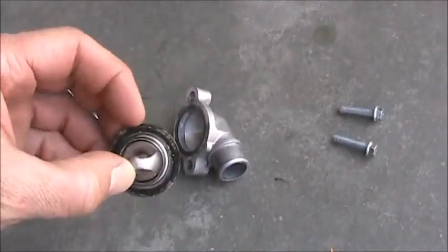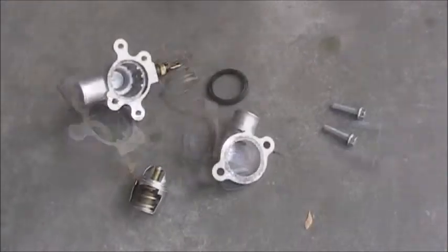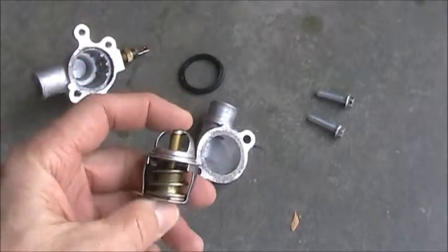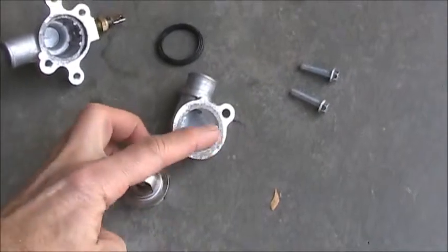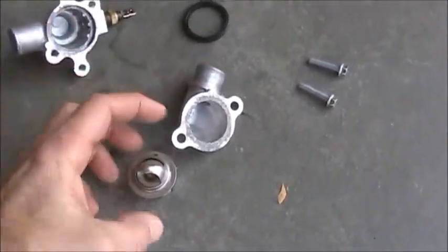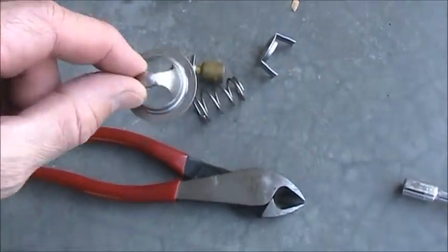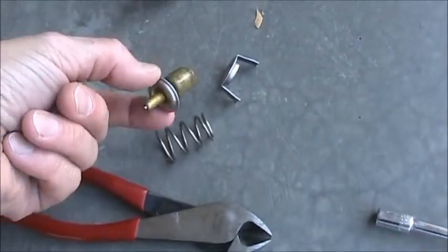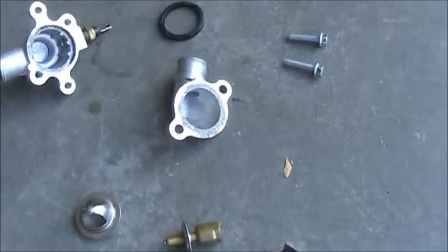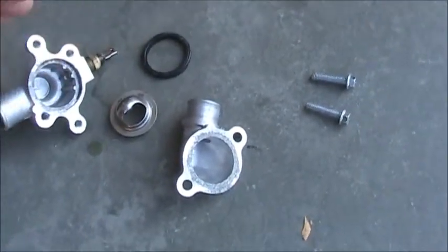It popped right out — just a little crusty with the stuff that builds up inside cooling systems. I'll clean that off before I put it back together. Now I'm going to cut it to remove the thermostat from the housing, because the circular flange on the outside has to be put back into the casing of the original thermostat housing along with the washer that makes it waterproof so it won't leak. That only took a couple of moments. What's going back in looks like this — the thermostat element, spring, and bottom cage are gone. The parts we're keeping are the housing flange, the washer, and the outer pieces, which will all go back together.